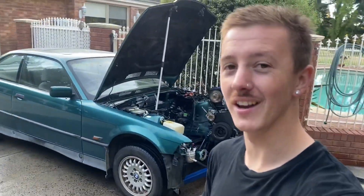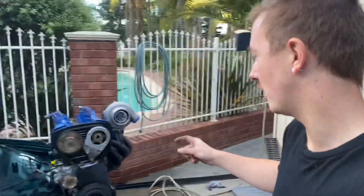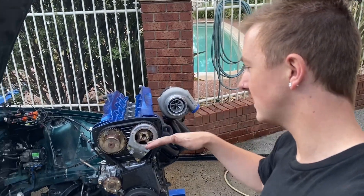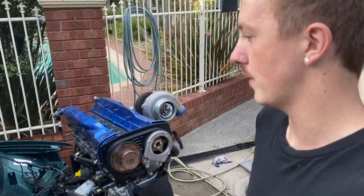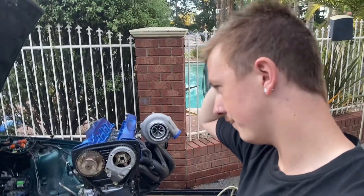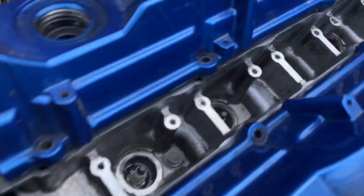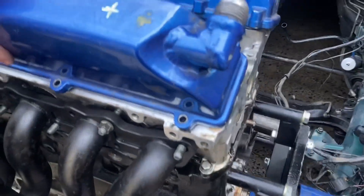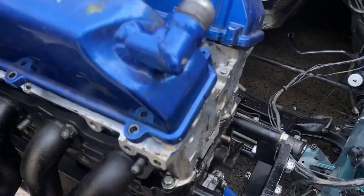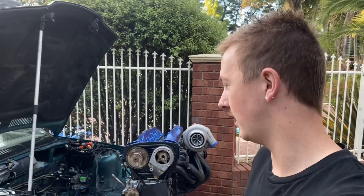Just like that, this video is done. Pulled the motor out, got this motor on the stand and cleaned up. Next job on the list is to start on the engine mounts — first thing is pull the sump off and then slot it into place, figure out the right way it wants to sit. I'll try to measure up the one in my track car and see if I can get it the same sort of angle. Very nervous about doing this — I really think I should just buy those mounts. I tried to clean up the engine a bit but still a bit yucky. Cleaned the valley as best I could but ended up getting water in under the cam cover, so I soaked it all with WD-40.